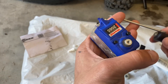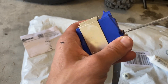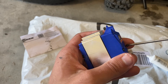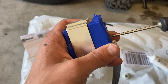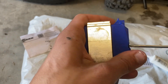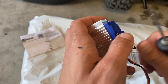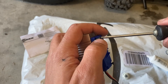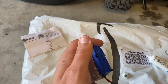Now we are going to install the top cover. Put our two short screws in the top, then switch back to Phillips head. This is also a good time to put a new servo horn on, whether it be aluminum or a factory replacement. My new servo horn is not in yet, but the metal gears are harder than my current servo horn. So if my factory servo horn has a little bit of damage and strips, luckily it will be the servo horn that strips and not the top gear - because the gear is now metal. My servo horn is now my weak point, not the servo. Now I'm installing the four long screws on the bottom.